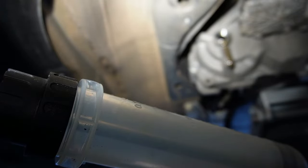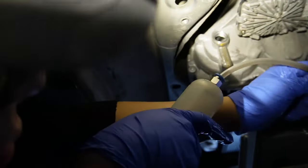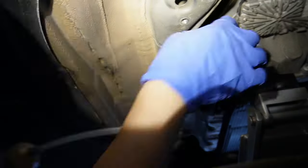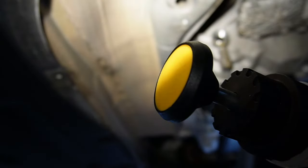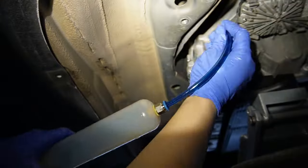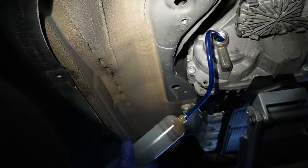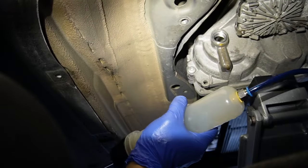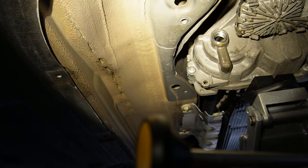With the fill plug off, there are just a couple of drops dripping out from the fill hole, so don't worry about getting splashed. I'm struggling to find the right angle to feed the adapter in. With a flexible hose like this it kind of works, but it's not even 15mm in, so I tried to abort that idea and use another flexible hose, but it was still not working. I would advise you to have your finger run over the opening of the fill plug to find where there is an indented area — that's where you should feed your hose in. Even the blue hose is way too big to feed into the opening, so you'll need something like a dipstick tube to be fed into the reservoir to extract the fluid.